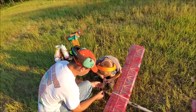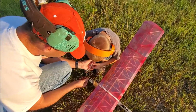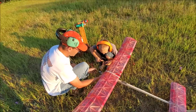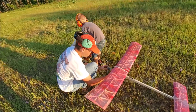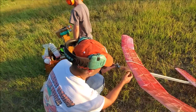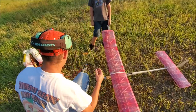We're going to flood the engine doing that now. So what we're going to do is suck a little bit out of the venturi there. And hopefully we haven't flooded it too badly. It should be okay. We'll flip that through a few times. We already have the timer set for about 3.5 seconds, which should be good, as long as somebody remembers to start the timer.